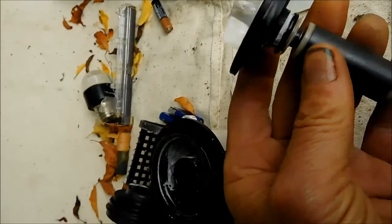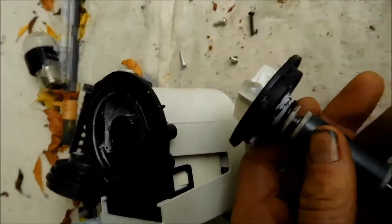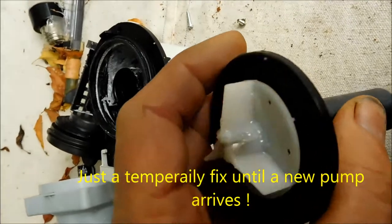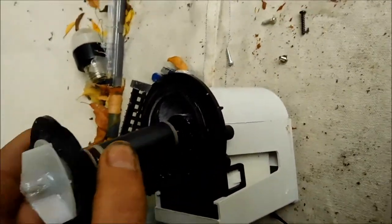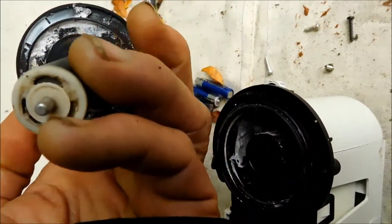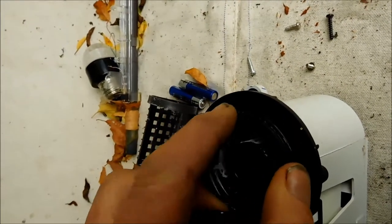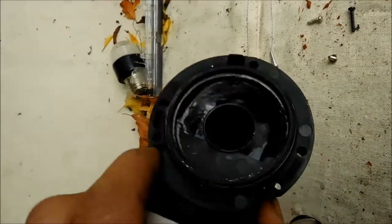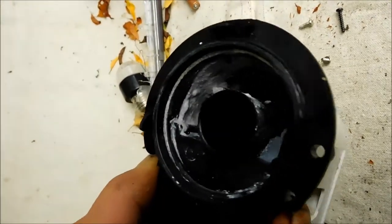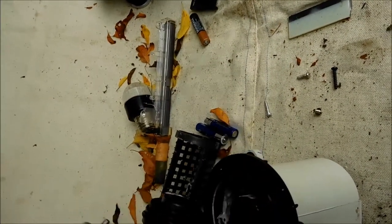I'm not sure how long it would last, but it is repaired. I have one I just repaired yesterday and it's running five loads a day — it's probably on its second load already today. These pumps actually get filled with gunk. You might want to put a little bit of silicone or Vaseline around this edge here because they tend to fill up with debris inside there. You might also want to put a drop of oil on the end of the shaft when you put it back together.